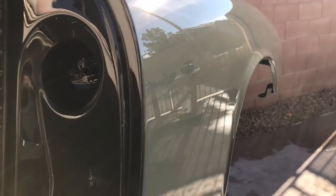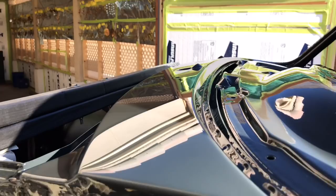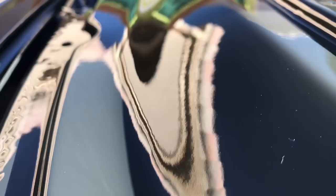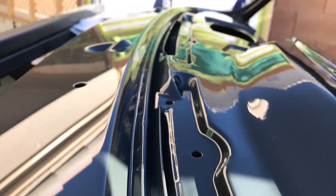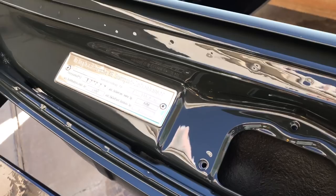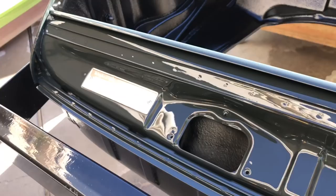You can just follow up with a polishing glaze. Looking across our valance here, we've got a real nice reflection, but you can see the old orange peel inside the dash showing how our new finish has definition but just isn't quite a real sharp mirror image. For the front valance area, even though it's small, you can get a lot done with hand sanding — get your pads in there and work it with your finger and thumb, press it in there — and also basically a drill with a 3-inch polishing pad. I also polished up our Vintage trim just so it can keep up with all this shine. Overall, I'm going to say the polish job is about 99.7% there, leaving a small margin for when I complete the car to just go over it one last time for any touch-up.